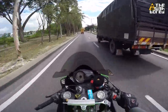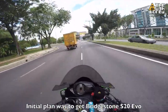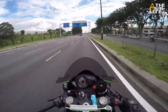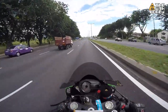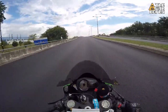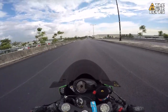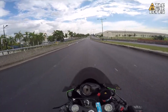We're done with our tire change at the back. It was supposed to be the Bridgestone S20, but at the last minute I decided to go with the Metzeler M7 this time. Before this, my tire was the Metzeler Z8. So right now I'm running the M7, and it's a 180 cross-section compared to the previous one which I had updated to 190. I can tell immediately that the bike is more nimble — it feels easier to flick side to side.